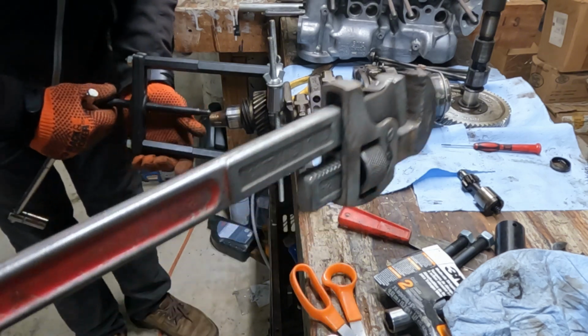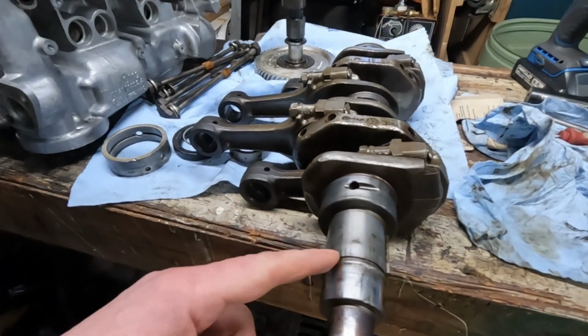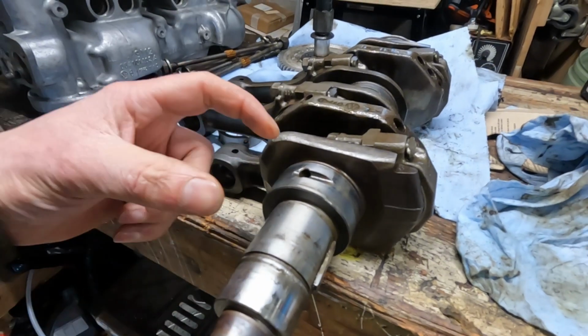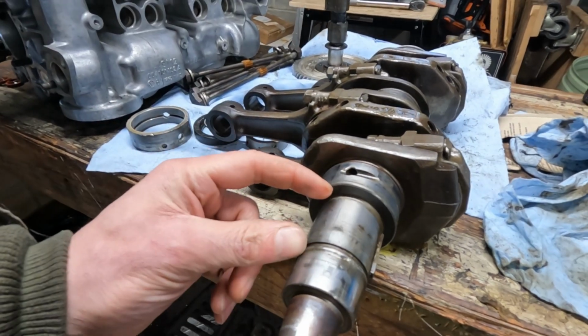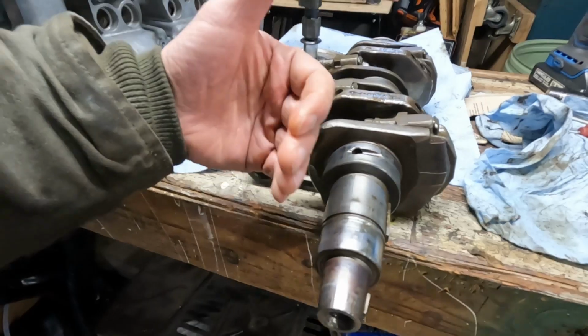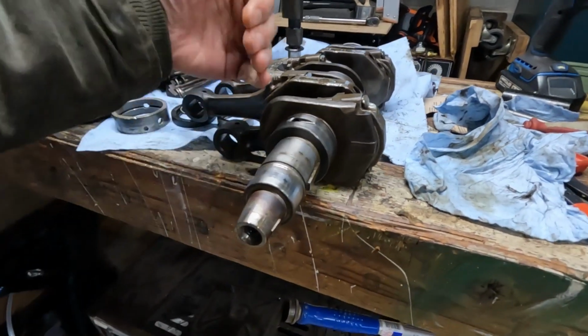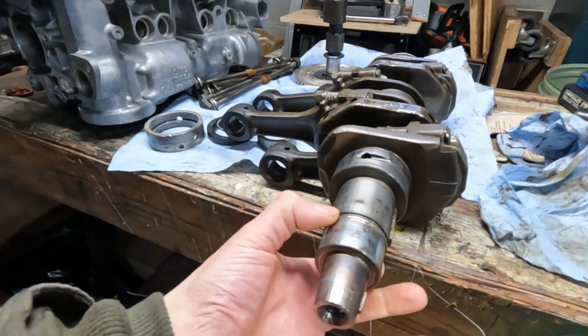The threads. Okay. Eventually, we saw the C-clip, and it was a little bit more difficult than conventionally removing the C-clip from this groove here, because we had actually pulled the gears forward and it was pressing this C-clip toward the camera here, and it made it even more difficult because we were battling the friction of the gear pushing on the C-clip. So kind of difficult to show you. Probably should have monologued over it yesterday, but you live and learn.